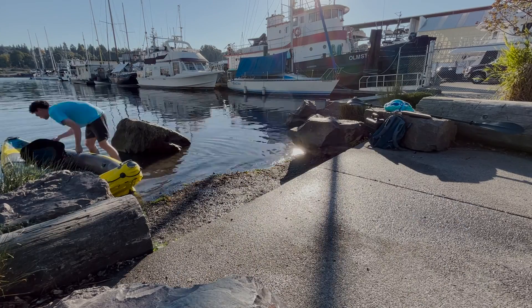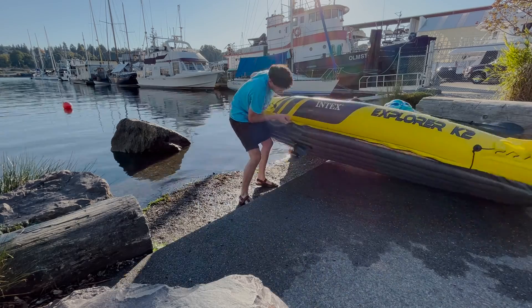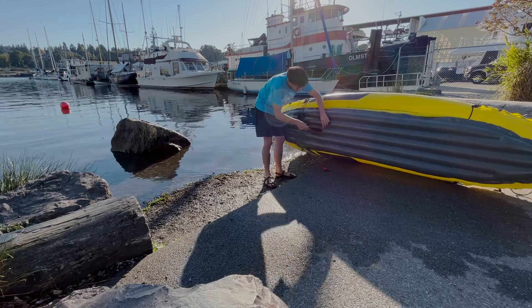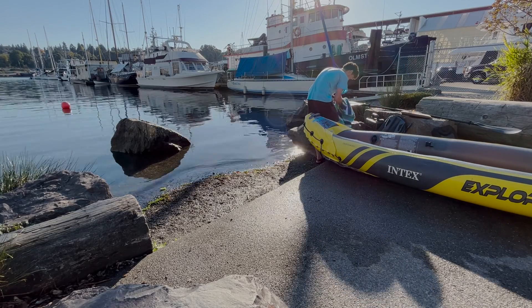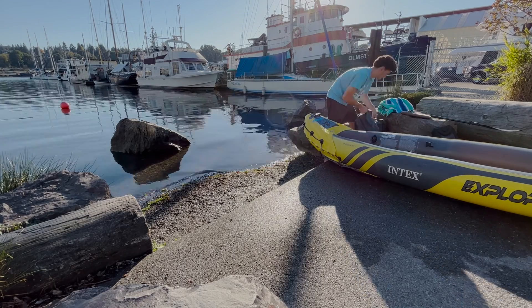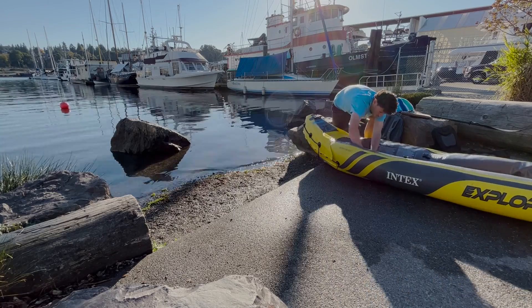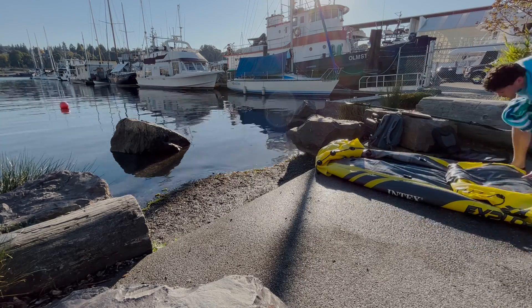Overall I'm super happy with how the testing went. Number one, the kayak doesn't steer straight at all, so I'm going to have to look into stabilizing the fin or adding a servo for heading control. Number two, I expected my range to be about two hours, but it turns out it's about four hours - like a 16-mile range. I think I undersized my battery voltage-wise, so I could bump that up to 44 volts and get more speed with a little less range. Number three, seaweed gets caught in the motor, so I need to design a prop duct to prevent that. The next phase is to get my computer out of the loop and have a Raspberry Pi commanding the speed controller, and build out all the final hardware. Stay tuned!